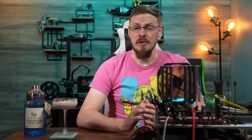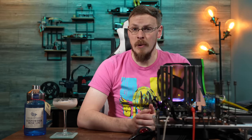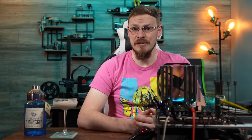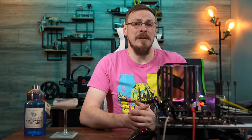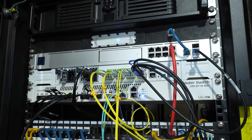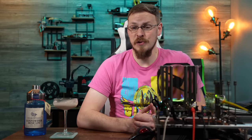Configuring these was an absolute breeze, as they offer both a Windows client as well as a web-based GUI to access from a web browser. All the menu options and different configurations are laid out very plainly and are easy to find, so thumbs up for that. Like I demoed in the first half of the video, the Intel optics that I purchased worked perfectly with the MikroTik CRS504 and auto-negotiated a 100 gig link with pretty much no hands-on from me. That definitely would not have been the case with the optics had I gone with a mainstream Brocade, Arista, or Cisco switch for a backend.